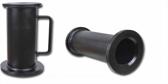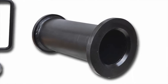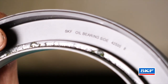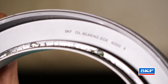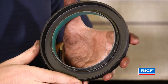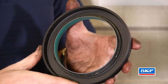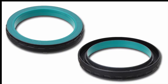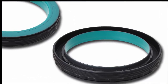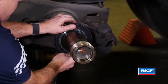When you're installing the SKF Scott Seal Hybrid, ensure that you use the proper SKF installation tools. When installing the Scott Seal Hybrid seal on the spindle, make sure it's properly positioned with the bearing side out. The SKF Scott Seal Hybrid does not require any additional sealant on the mounting surface or the seal itself. It uses SKF bore tight as a sealer and a filler, so no external sealer is required. Place the Scott Seal Hybrid onto the spindle shoulder.